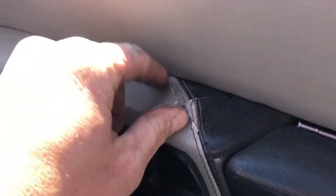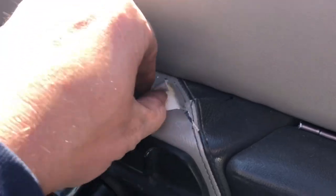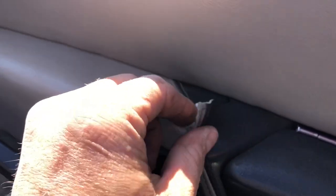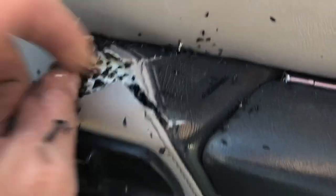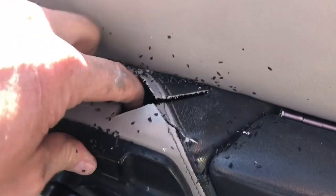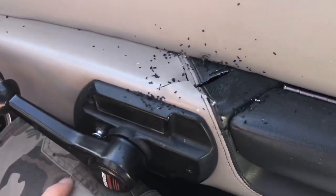After that, what we're going to do is take a very, very small drill bit and drill a bunch of holes around the outside underneath the edge of the vinyl, so not through the vinyl. And what we're going to do is cut out the box. Okay, so where we've gotten so far, we've drilled little holes, connected the holes with a drill bit, cut out the square, and now it looks like this. We got some scraps, but the edges fold down around. And we then are going to place our switch in.